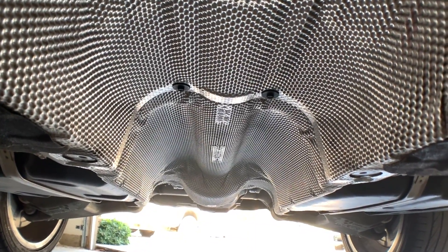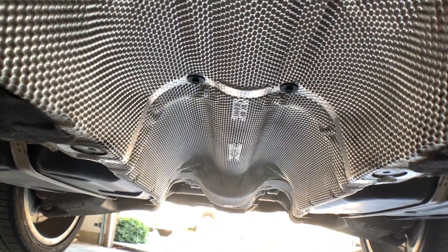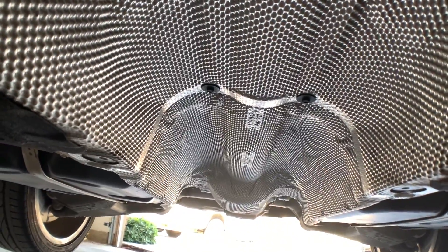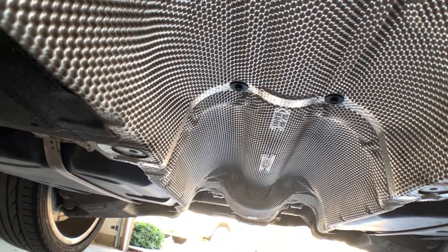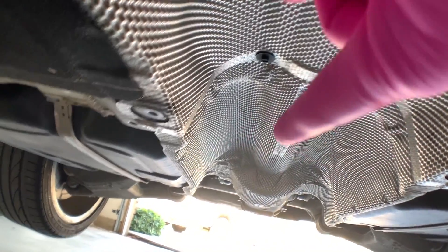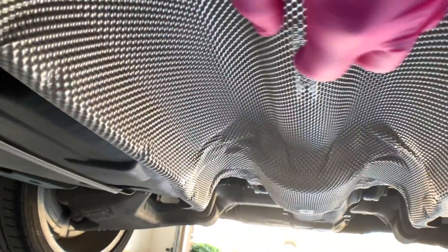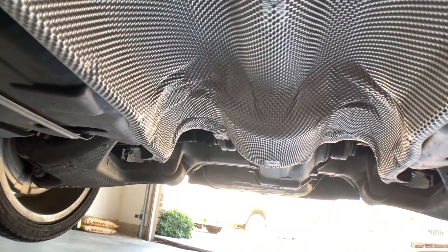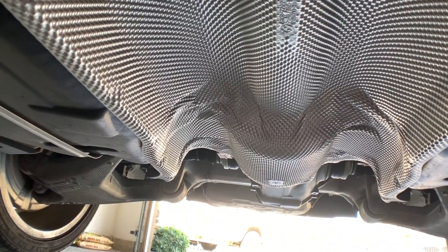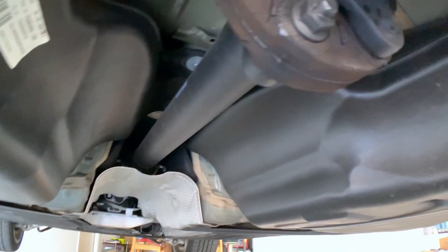I had some fun with the no-exhaust setup — I'll put a link for that in the description. Now this heat shield has to go. It's at the rear axle. We just open these screws, not take it out completely, just loosen it so I can pull this one out here. That will give me all the space to lower the diff. So now we're finally getting closer.